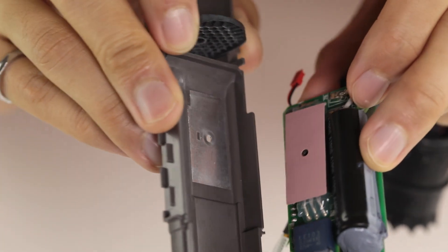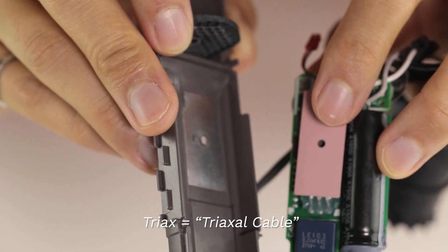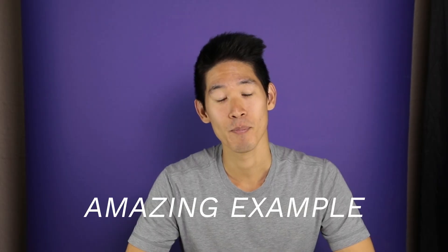There's also a super interesting insert-molded aluminum heatsink in this enclosure that mounts directly onto the back of the triacs with a thermal pad for heatsinking. The Dyson Airwrap is an amazing example of great engineering work and design for manufacturing.